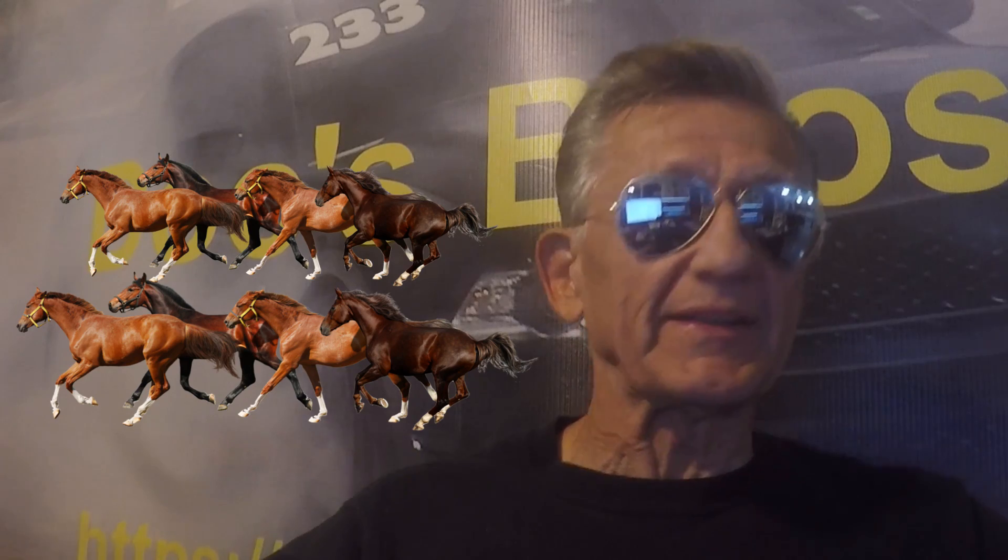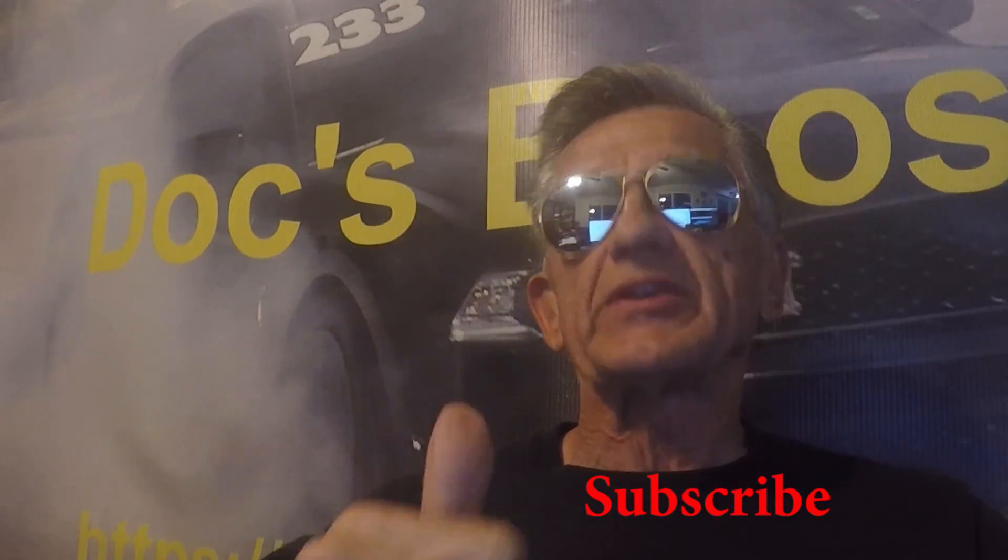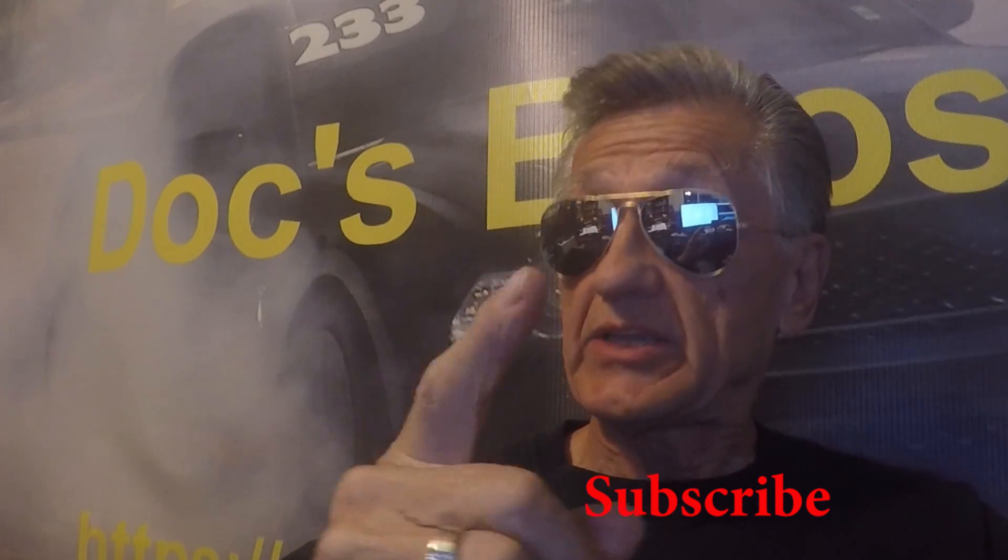It certainly looked like there was a lot more horsepower being delivered — that's for sure. A lot of smoke, there always is. It's about time to close this video out. I hope it's going to help you get off the fence about taking the challenge of putting a new throttle body on your vehicle. It's an easy task — just make sure you measure the voltage on the old one before you take it off. That's the critical issue. Other than that, it's all downhill. Just follow the instructions. Thanks for watching and we'll see you in the next video.